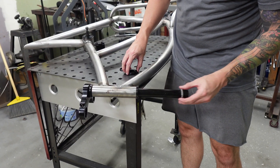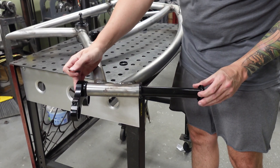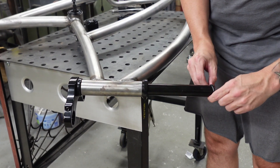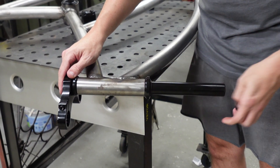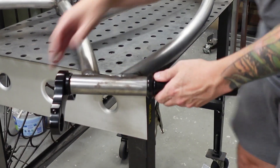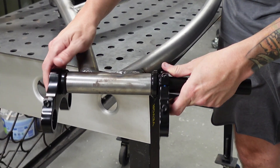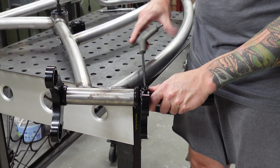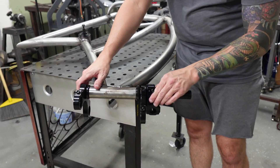Here's where you're going to get your measurement to start cutting your steering tube. With your bearing on, you've got your top cap — from your top cap you're going to have a piece of rubber that goes on, it's like a rubber washer. Make sure that the part where it's facing down slides in, and then you're going to have another washer that goes on top of that before you put the top of the triple tree on. The top of the triple tree goes on there — just kind of make sure everything's nice and squeeze it so that you can make sure that there is no play in the center of the head tube. That's the most important part — you don't want any play.